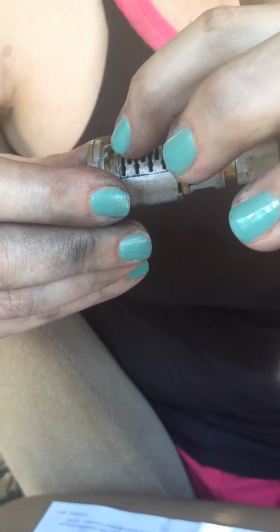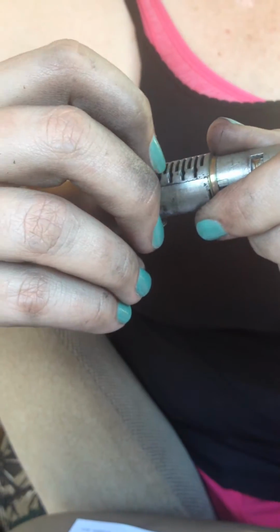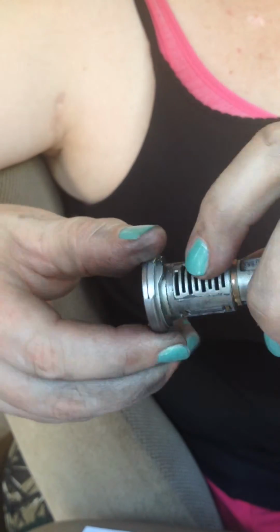These little suckers here are called tumblers, and they come out of here in these little slots, okay? Now you just have to keep track of which slots are which. There's 4 on each side in opposite slots. Obviously there's one here, and then there'll be one here, so on and so forth. So there's a total of 8 on these. Like this was, I've wiped these off and everything. These are so old, it's no wonder this thing stopped working.